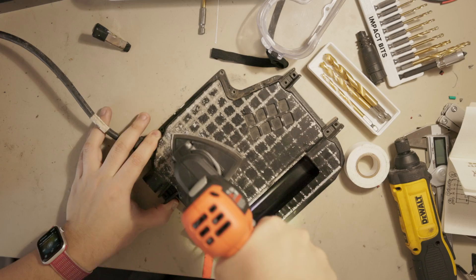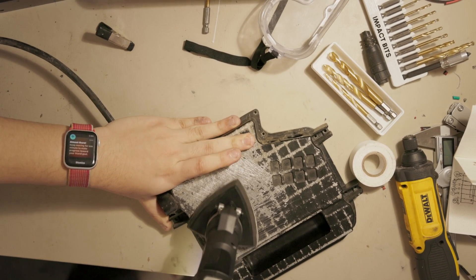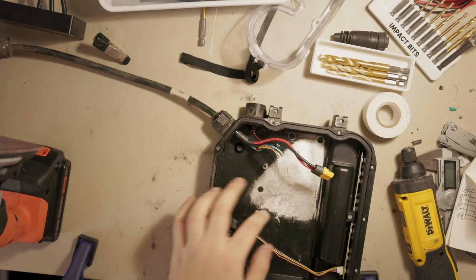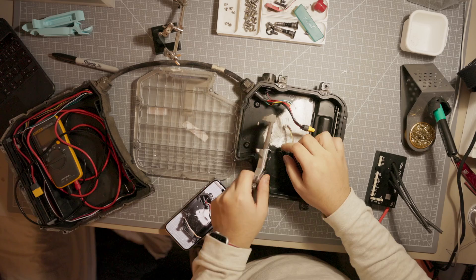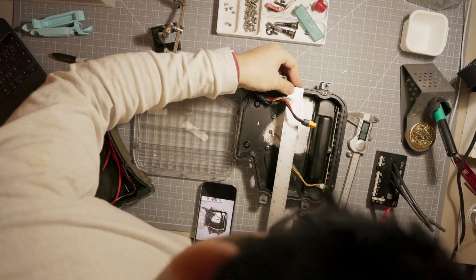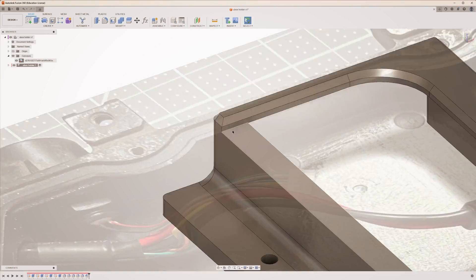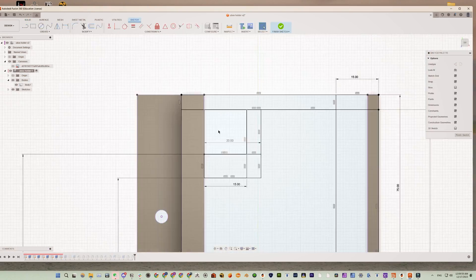While I'm at it, I'm also going to sand down the bottom side. By the way, highly recommend this Black and Decker power tool — it does all this and a few more tricks all in one package. Next step is making some kind of holder that can fit the U-Box in. I don't want a riser because going through five millimeters of thermal pad or aluminum will completely destroy the thermals. I want the U-Box to be pressed against the bottom of the box, and I also don't want to drill studs because I want this box to be waterproof. So it's time to take it to Fusion 360 to whip out a holder.